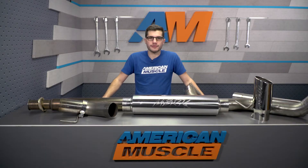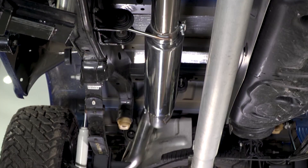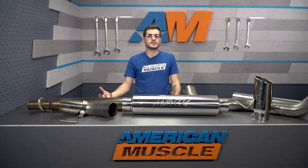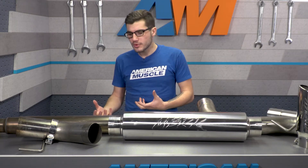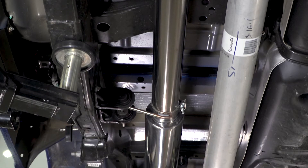This one does come in right around the $500 mark. The price tag is gonna go right in line with the materials — since it is 409 stainless steel, it's a durable one, but obviously not gonna be as good as 304 stainless steel. The 304 stainless will go for $700, so just about $200 more, and it all comes down to whether you're willing to pay that much more for the exact same sound but just better materials. If you're looking for a pretty budget-friendly option with good materials, this is gonna be the one for you.